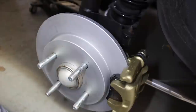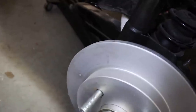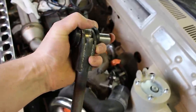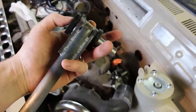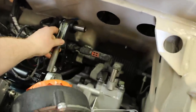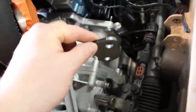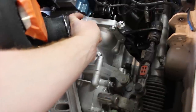That's the rear disc on, and I've just got to sort out all the brake lines off the car onto the axle. Should have really done that with the axle off, but hey-ho. I've also been working on the top brace bar. Georgie Boy at work sorted me out with these new bushes, so I just need to trim them back a bit so they fit in the gap. That's the new bar at a longer length, so that'll go in. And then I've got to shorten the rose joint bit on the end. One of the comments was saying about mountain bike back suspension arms — they run the rose joint just on one side. So I've made this little plate which will sit with the rose joint between there and the starter motor. Hopefully it'll fit, but we shall see.